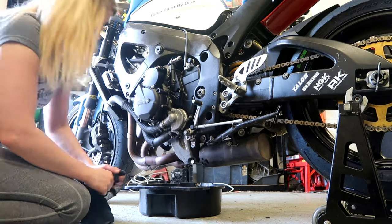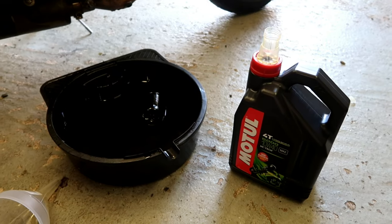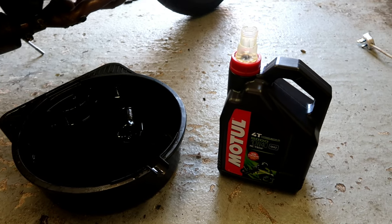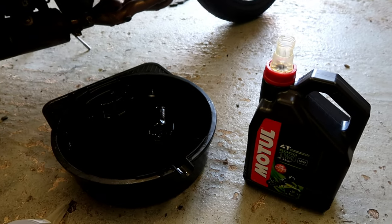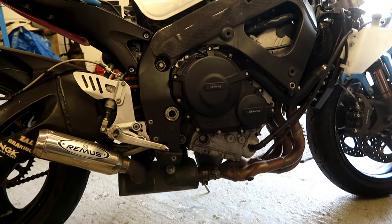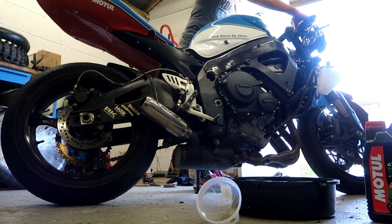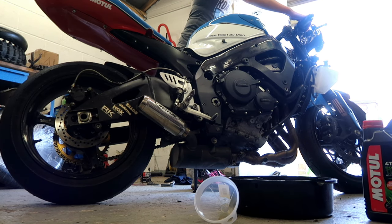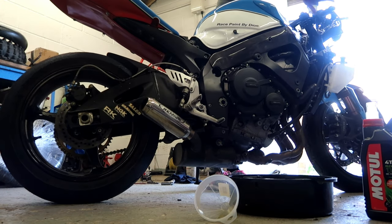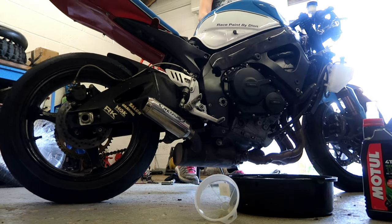After the old oil has sufficiently drained out of the engine, this is where you put the sump bolt back in along with a fresh crush washer for an optimum seal. Frustratingly, it didn't film me putting the oil in the bike, which is a bit irritating, but we put in about 2.8 litres — just because we haven't pre-oiled the filter. So rest assured there is oil in the bike. I fired up the bike for a couple of seconds to let the oil travel around the engine. After this I held the bike upright and Mike checked the oil window to make sure it was filled correctly and not over or under filled.